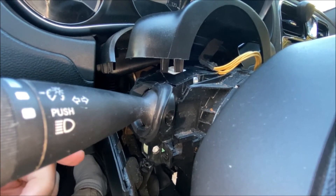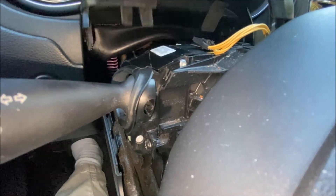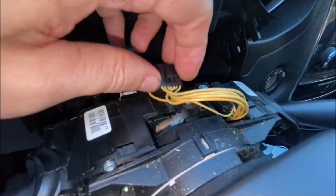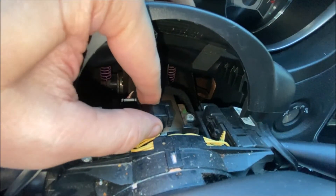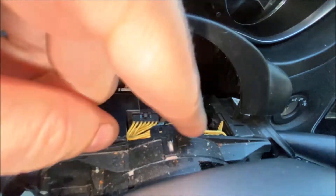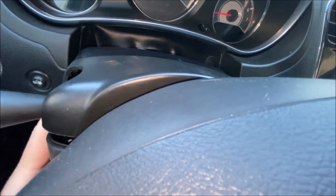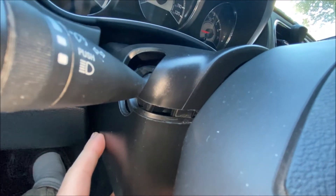Just like that, and then the screw will go in next to get it fully seated. With the screw in place, go ahead and reconnect the electrical connectors just like when we took them off. Once the harness is connected, tuck the wiring underneath this little plastic bracket so it's not going to get in the way of the shroud. Then slip the shrouds back in place, lift one up from the bottom, tuck the tabs in on the side so it all comes together, and put those torx screws back in place.